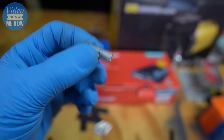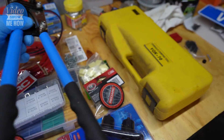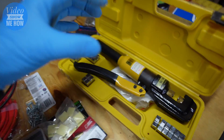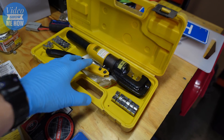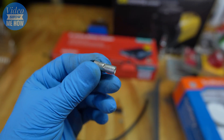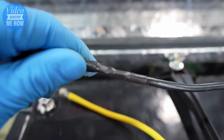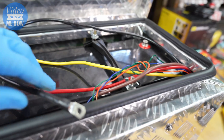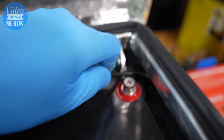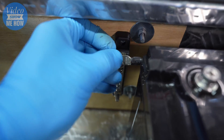As far as actually crimping these onto your cable, there are a couple of different ways: you can use a manual style crimper, or there are hydraulic crimping tools with a whole bunch of different dies that give you a really solid crimp. I have a full how-to video on how to use both tools if you want more info. Here's the end result — a nice good quality connection with our joiner. The main thing is to take your time and ensure a really good quality connection. Once our earth is ready, feed it through underneath, then temporarily install it into our bus bar until we do our final connections at the end.